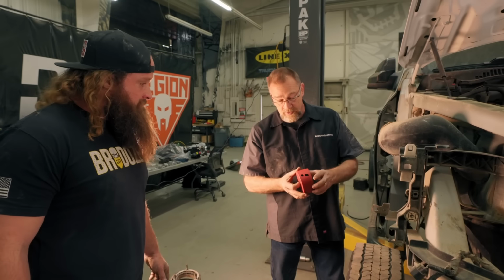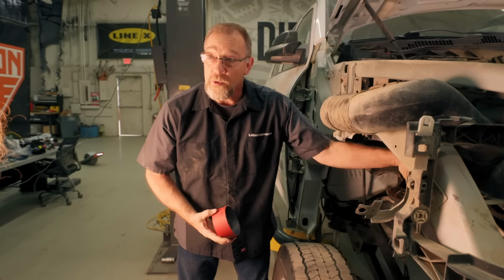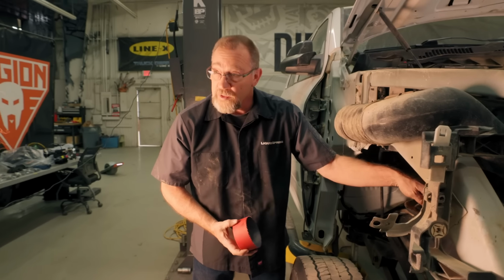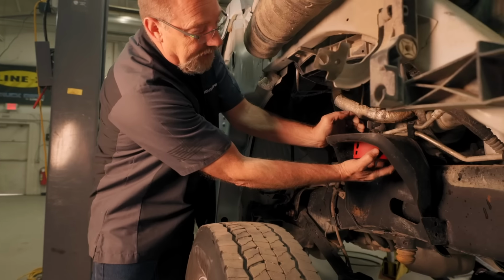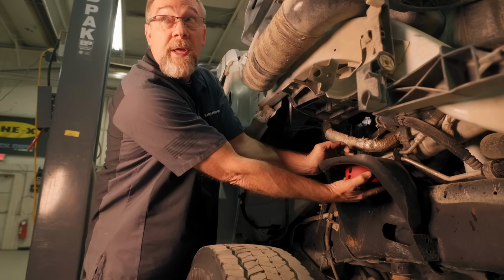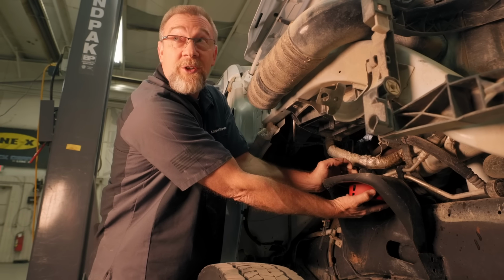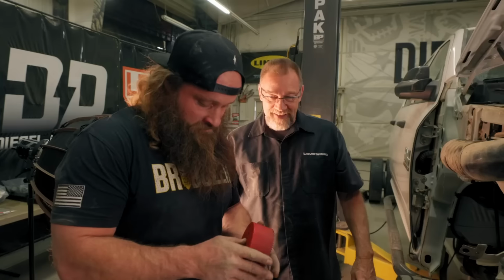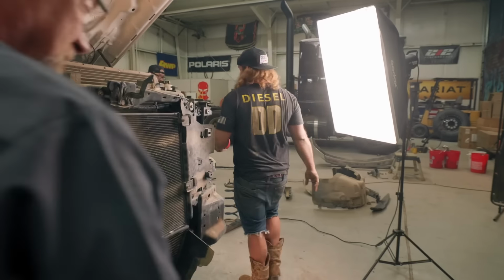So the project now is a 4.5-inch hole saw. We're going to open up the pocket so our strut can come through. So this is a beveled edge, so we're going to use that as our centering tool. That'll come up from underneath, and then bore a 4.5-inch hole through there. I'd recommend maybe a 90-degree or a very strong wrist. All righty. Doug, I got something for you.